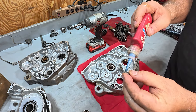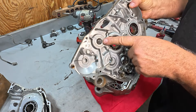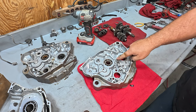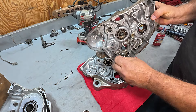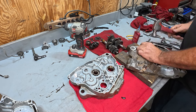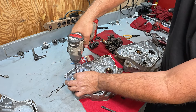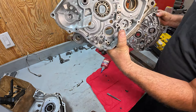Any bolts internal in the engine, use red Loctite. Now the reason that there's a hole in the back of here — for whatever reason they drove this pin out — that's probably why they did it. So I drilled into that one, knocked this pin out, pressed it in here, and we just sealed that hole up with a little JB Weld. Obviously they had taken this off, so we're going to switch this over. We also have a pin right here for the shift shaft that I have to knock out and get over there as well. For whatever reason they even took this stud out of this case — selling all these parts separately.